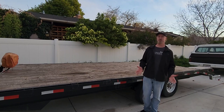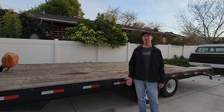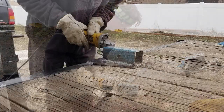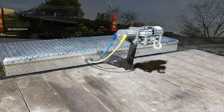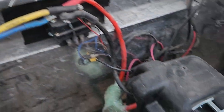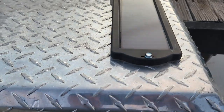Of course, we weren't going to use this just to haul our wheeler — and sometimes our wheeler might break down — so we added a winch. We welded on some square tubing and flipped over a drop hitch to mount our winch. This helped get the winch up off the deck so that the cable wouldn't drag so much. The battery is mounted inside the toolbox, and we have a solar trickle charger mounted on top to keep it charged.